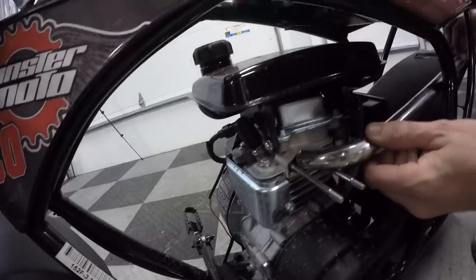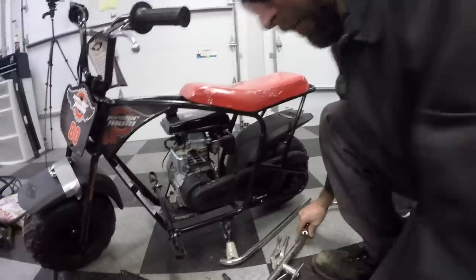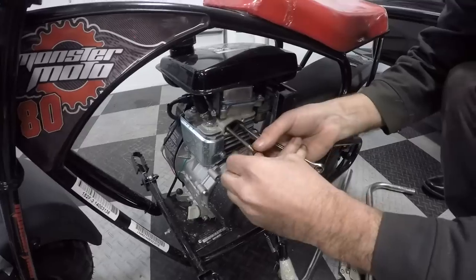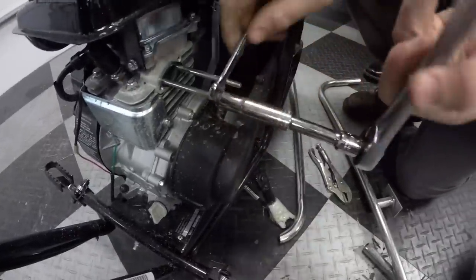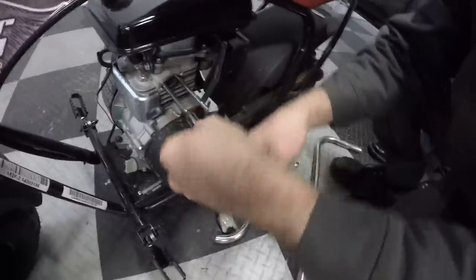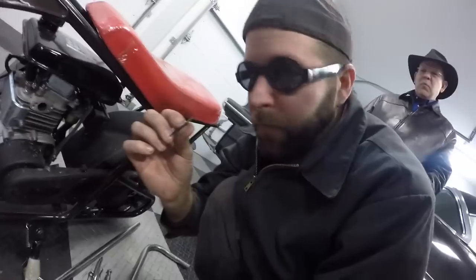Let's see the fitment on that bad boy. Did you see this? Oh, man, that's beautimous. Nice. Oh, yeah. That is gorgeous. Here's a good tip for extracting these studs from the block. You put two nuts on, so they're jammed together, and that's it. See, you're learning things on Cars and Cameras today. Yep. What do you learn on MTV? Save the gasket, because we're going to need it.